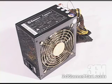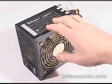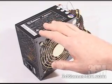This power supply has a continuous wattage of 400, which is adequate power for today's computer systems. Now, how is this wattage determined? Well, to understand that, you need to know what rails are. Rails are basically well-regulated transformers which convert domestic current into the voltages that your computer system can use. And there are essentially 2 different rails, the 3.3/5 volt and the 12 volt rail. In this particular case, the approximate maximum peak output of the 3.3/5 volt rail is 150 watts and the 12 volt is 230 watts, which is essentially how the wattage of this power supply is determined.